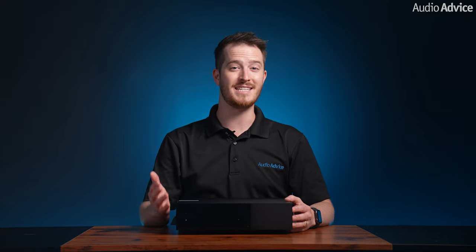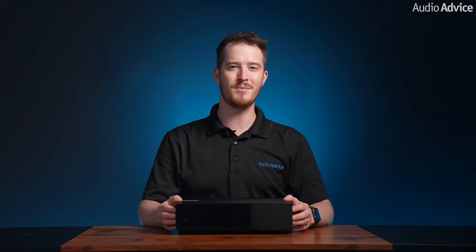I said we were going to talk about the Evo CD transport, but first I should probably explain exactly what a CD transport is. A typical CD player has a CD drive system which takes the digital signals it picks up and sends them to its built-in digital-to-analog converter. The CD player then converts those bits into music and outputs the music as analog audio from its output connectors. There are pretty big differences in CD players based upon how good the drive is and the quality level of the digital-to-analog converter, or DAC for short.